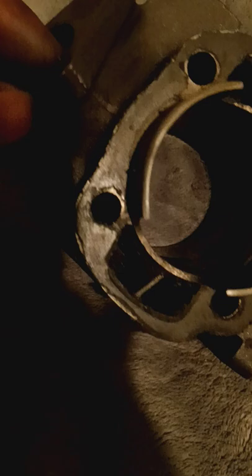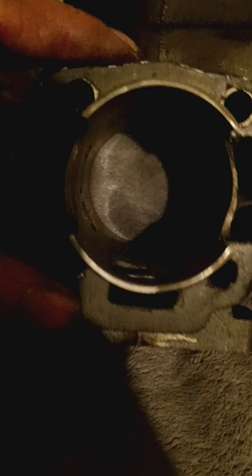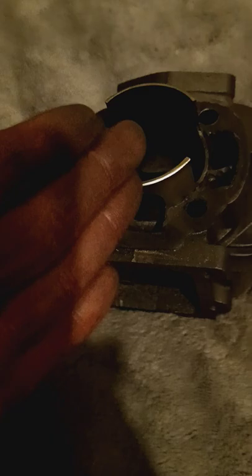It's good when you're drilling these out when the cylinder is brand new - no oil or debris to gunk things up. Same thing with porting and doing all your stuff. Basically I'm going to wash it with Dawn dish soap and the water hose or pressure washer, then dry it and do all the dremel work. Basically just open up this one here a bit wider and maybe the exhaust a little bit more wider. If I had a fresh one I would perfectly match this one. I might even change the piston and skirt it like I was talking about.